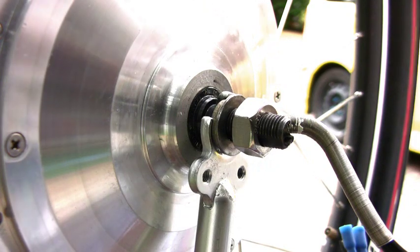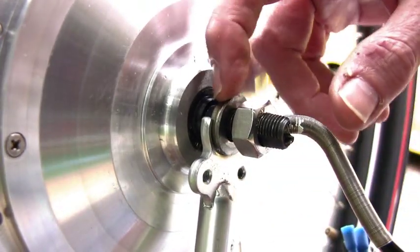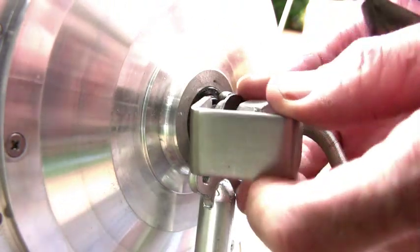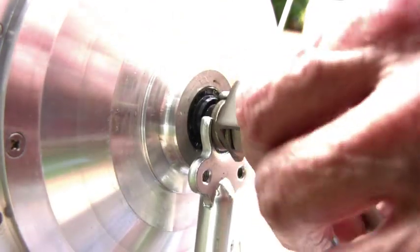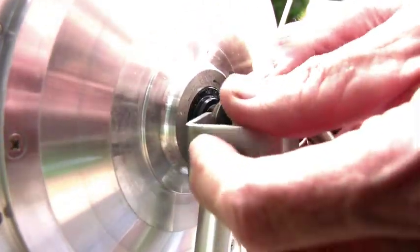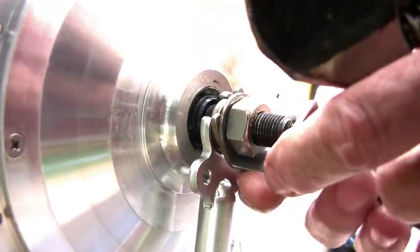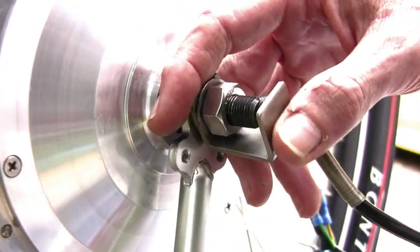The misery of misplacing your tools because you haven't used tools for years. So here's the wire side. The safety washer is sitting inside the dropout flange. Then comes the flat washer. I need to look at Justin's instructions to be sure. I believe this is the wire protector, and it's keyed so it will only go on the shaft one of two ways. That protects the wire. I'll put it on from this side. I'll double-check his online instructions, but I believe that's the way it would sandwich — that makes the most sense.